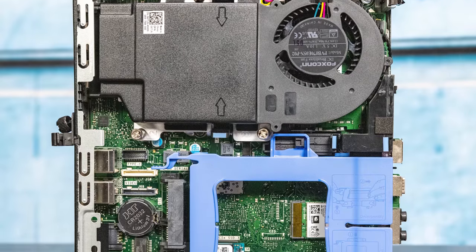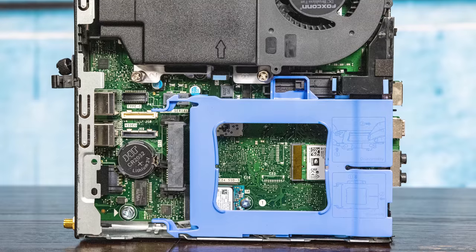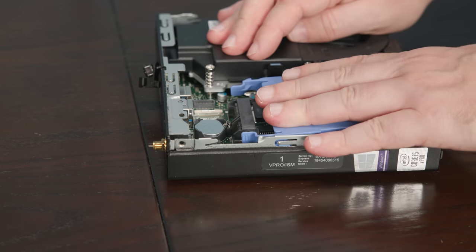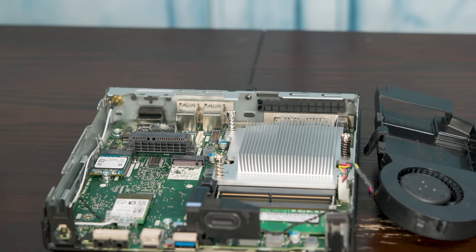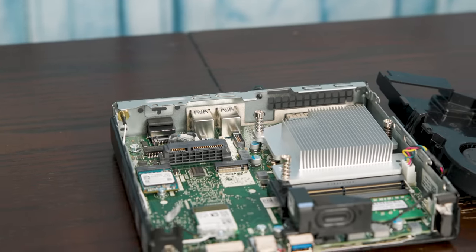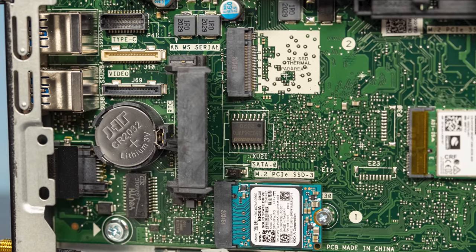Underneath the CPU and memory area is the storage and I/O section. The first thing you'll see is a little blue cage — a two-and-a-half-inch, totally tool-less hard drive adapter. You pop your SSD into it and then drop it into the SATA data and power backplane that's built in. I really like this hard-mounted SATA backplane because it's solid — some HP and Lenovo models use customized cables that are easy to accidentally tug out, leaving you wondering why your SSD stopped working. This is a very robust and secure mounting mechanism.